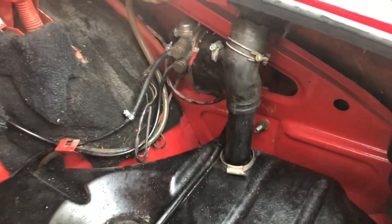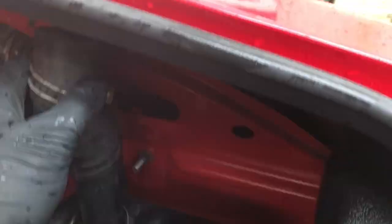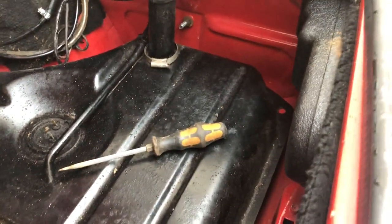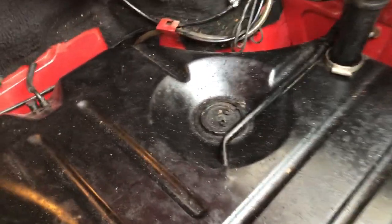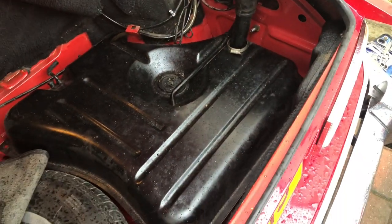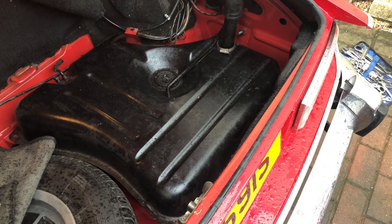For ease — I've taken the top jubilee clip off, so that's now disconnected from the filler cap on the outside of the car. That means the tank is able to wriggle out. I managed to release this end over here too, so we're all set to see what's what when I get it in the garage. Next shot: out of the rain, in the dry, fingers crossed.